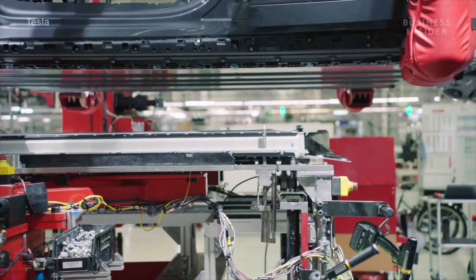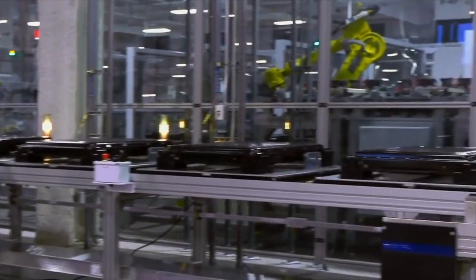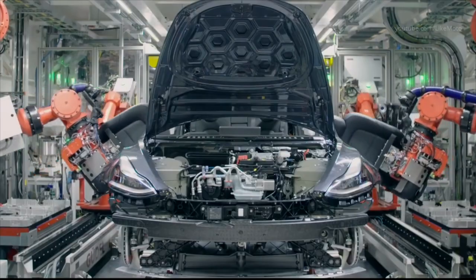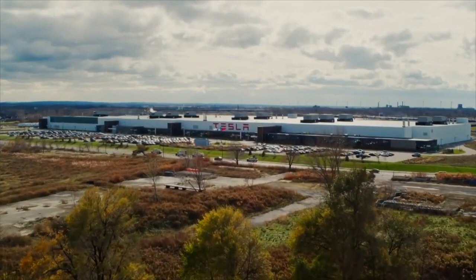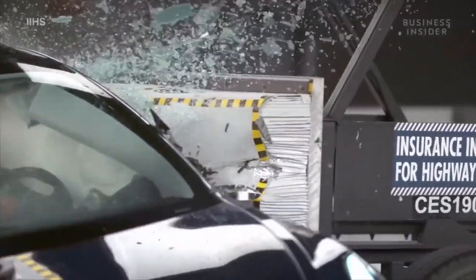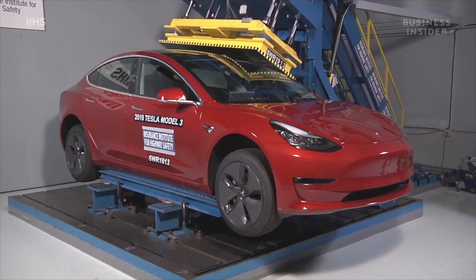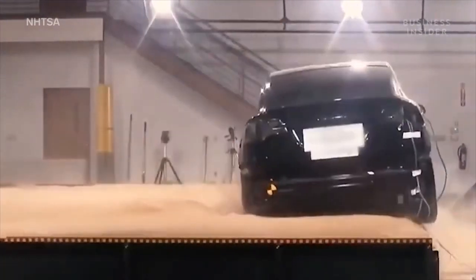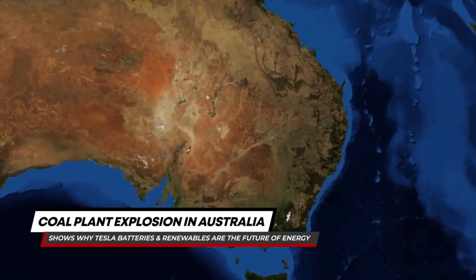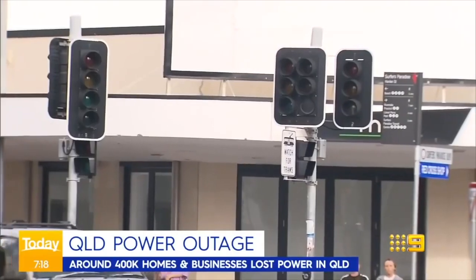Battery cells are massively complex and Tesla's latest rewrite of the fundamental building block going into its electric vehicles and energy storage systems might be challenging to digest — so let's put a bow on it. All told, Tesla's new 4680 battery cell represents a paradigm shift in automotive energy storage. The new cells are far cheaper and can store far more power per unit of volume. They have been redesigned as structural elements of the vehicle, resulting in a cheaper, more rigid vehicle. Tesla rolled out hundreds if not thousands of small improvements that bring step-change gains to the fundamental building block of Tesla's business, the battery cell: a 14% improvement in cost per kWh from the cell form factor change, and an 18% improvement from a 10x manufacturing footprint reduction and 10x manufacturing energy consumption reduction. The new dry manufacturing process enables pressing the active battery powder material directly into a film.